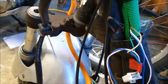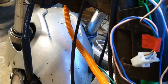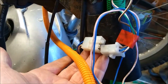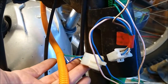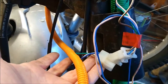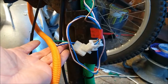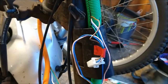I'm playing around with the cabling at the front from the headlight. I've temporarily fitted the orange conduit to the cables and now we are at the connector. I need to get rid of the connector because there's no way of hiding it in any neat and meaningful fashion, so I intend to pop the connectors out of the block and then push them together and use heat shrink to hold them together and to insulate them. That can easily be cut off when we need to dismantle the bike for painting. That should hopefully allow us to embed them within the conduit and run the conduit back down to meet the main loom.